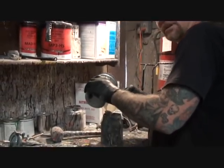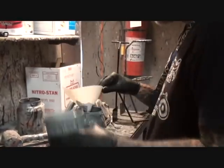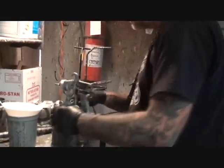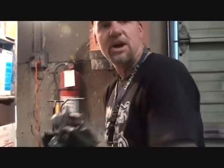Always use a strainer for your spray gun. I'm not mixing up a lot of primer because we don't have a lot of space to prime. I'm going to use very low pressure on this because I want more paint to go on than air. I've got my little buddy sitting there waiting for me — set my pressure down.